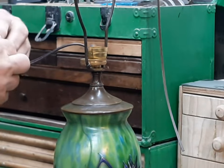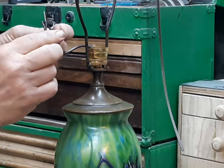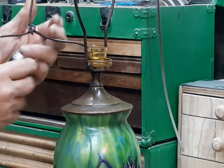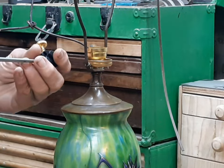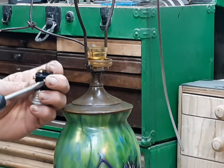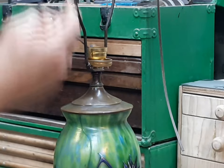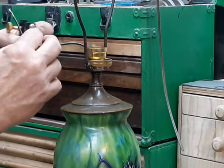This is the part where I talk about the underwriter's knot — underwriter's loop — a very critical part of any kind of lamp repair. This lamp had one. This little pretzel knot is actually a safety feature. Because if you're walking through a room with the lights off and your foot catches on a lamp cord, it could yank hard enough to pull the wires out from underneath the terminal screws. When that happens, you've got two live wires down inside a steel pipe, and someone bending over to pick up the lamp could get shocked or electrocuted — not a pleasant situation. So that's your first step.